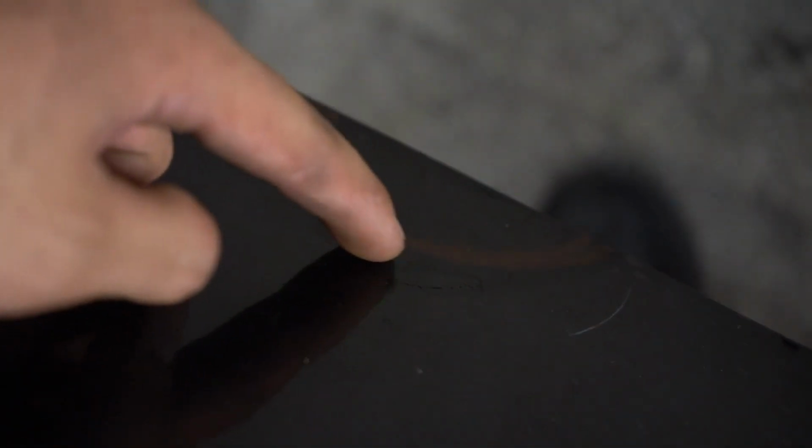That's the way it looks. I mean, it's not going anywhere. And then that bottom piece where the jack point goes, it hits right about there. I don't know if you guys can see it, so I marked it with a Sharpie. I'm gonna use the Dremel and just shave that area so the fitment is better, and hopefully it goes in good. And yeah, we're gonna see it.